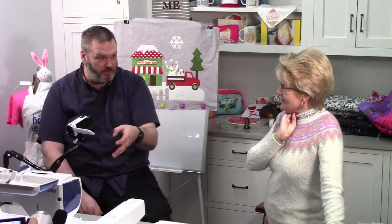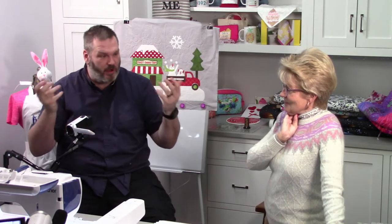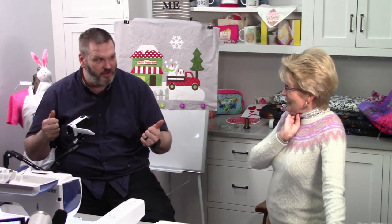As a hint, if you're looking at sewing or embroidery Brother machines, 35 million stitches means it's been used. I'm not saying that's not a low count, but it's in its midlife. 20 million stitches is when the maintenance light comes on. Just keep that in mind. If you do nothing to your machine except vacuum it out and oil it, at 20 million stitches you'll get a little man that pops up and says, time for service. Do you really? Yes. I've only seen, I think, four machines actually have that happen. I've never seen that. And mine runs every day.